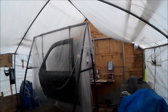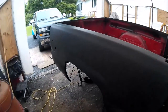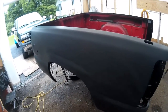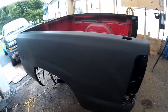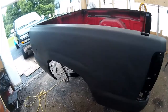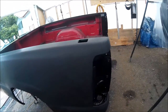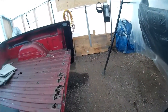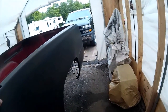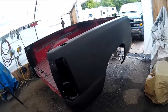With that being said, what we've got now should be a fairly watertight situation where we can concentrate on getting the clear and the pearl laid on this base coat and start moving on. Otherwise we're going to be another week waiting for conditions to clear up. The biggest factor we have now is the humidity — we're up around 70 percent, which is really high for this area.